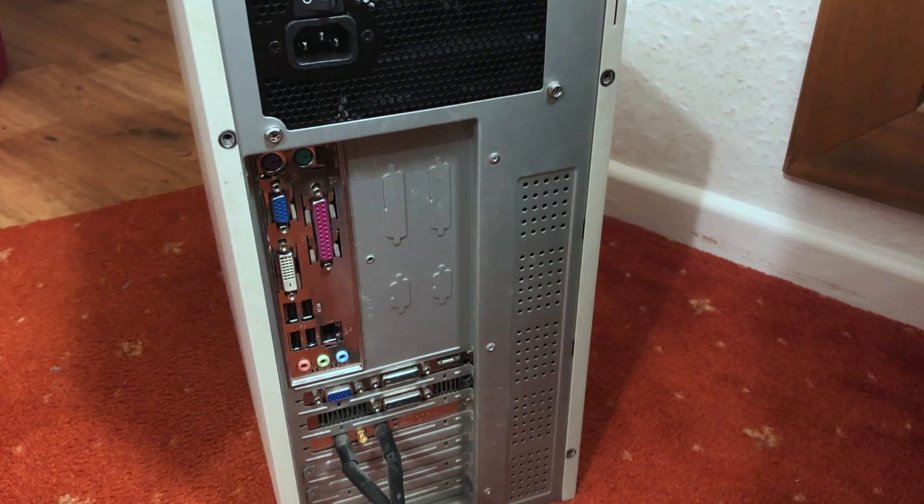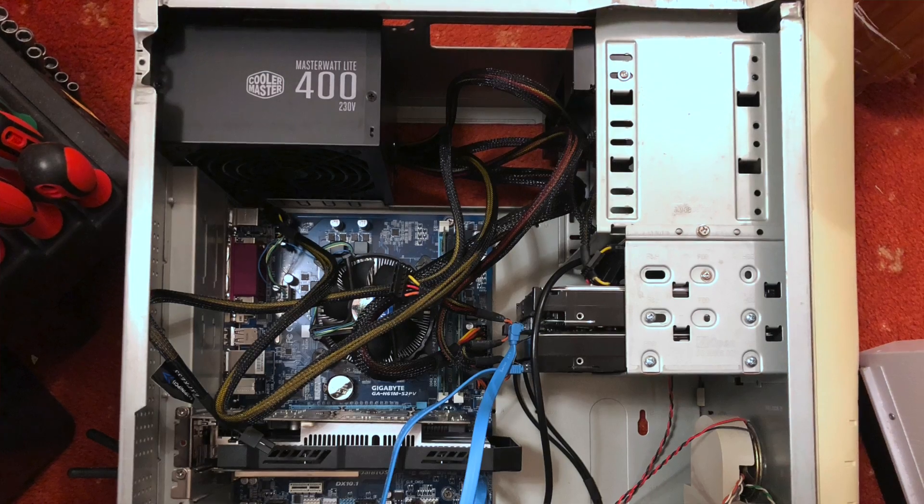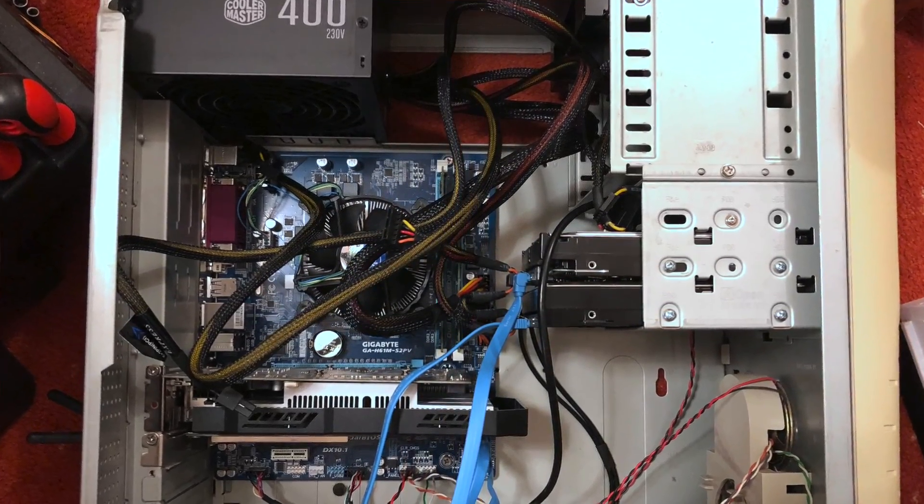So the first thing to do when you're installing a new solid-state drive is to obviously unplug your computer, because you're not going to do this while it's on or you might damage the computer or electrocute yourself. So unplug it, take off the case, and then you can see all the fancy electrical components and cards and things inside your computer. If you've never done this, don't be scared. Also don't electrically charge yourself and then destroy all the components. So it's a good idea to buy one of these — I've forgotten what they're called, but it's like a little wristband that basically earths you, discharging any charge that's built up from, you know, rubbing balloons or shuffling along the carpet or something like that.